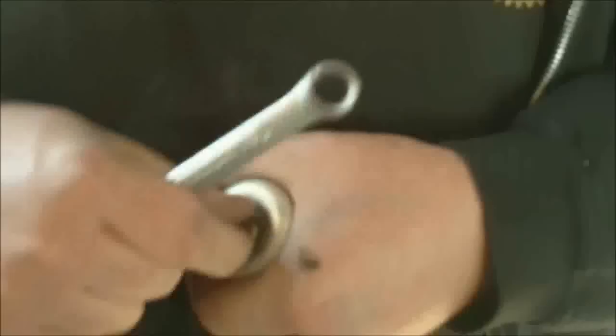Take a half inch wrench. If it drained oil, it wouldn't be because of the carburetor, it'd be because your air filter is either stopped up or because the drain hole in your valve breather is messed up.